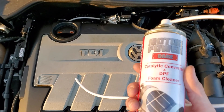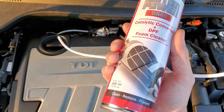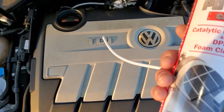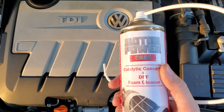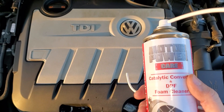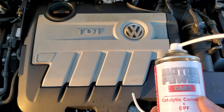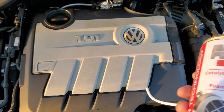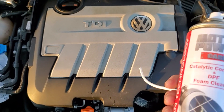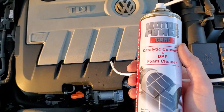After you're done with the first can, put back the O2 sensor and the DPF sensor if you removed it. You don't have to remove the catalytic converter — leave everything intact, turn the car on, and rip it for 2 to 4 minutes until all the white smoke is gone. I took it around the block after the first can for 5 minutes just to get it ripping hot and go past 2500 RPMs.